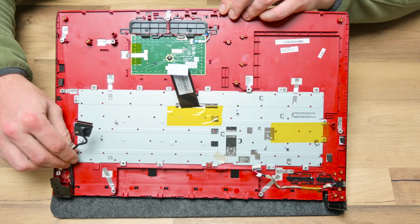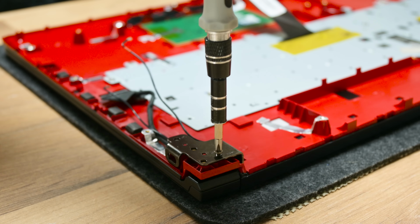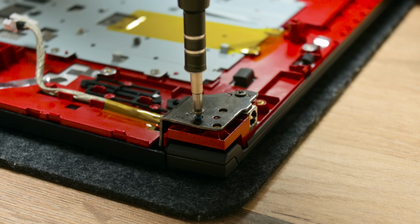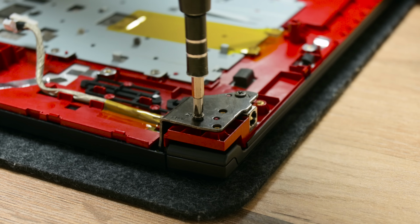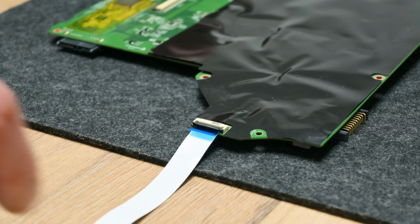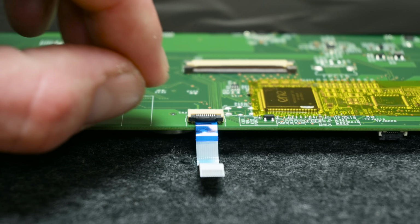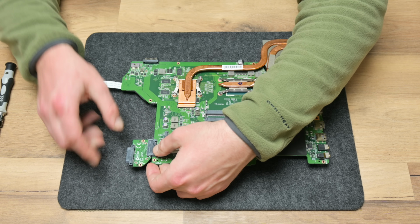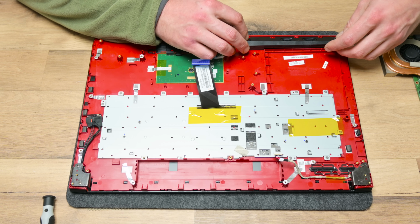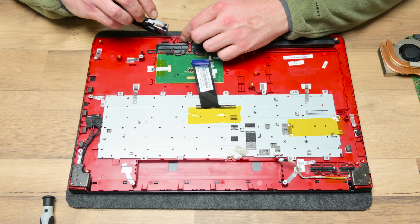In 2015, the last DDR3 motherboards were released, like the Z97 chipset 1150 socket and the X99 chipset 2011-3 socket motherboards. Also, that was the last year of the NVIDIA 900 series graphic cards. The next year, 2016, the DDR4 RAM hit the market, as well as new graphic cards like NVIDIA 1050, 1060, 1070 and 1080. And from AMD we got RX 470 and 480.